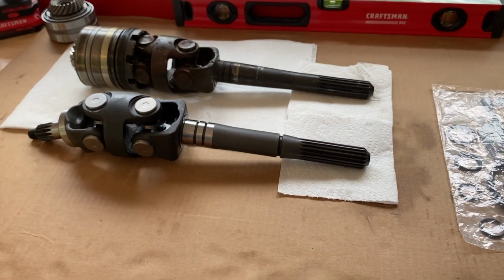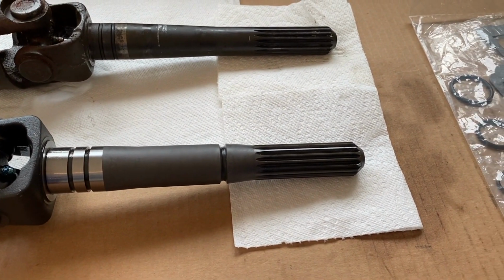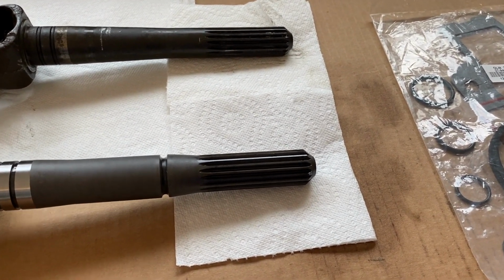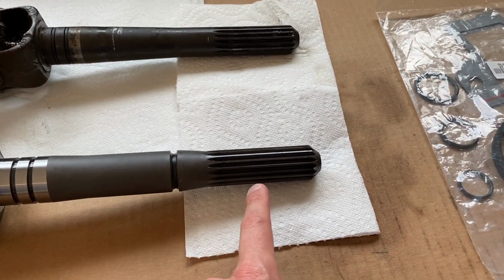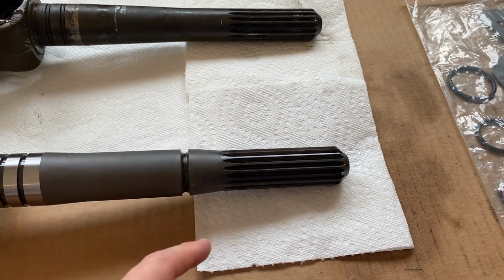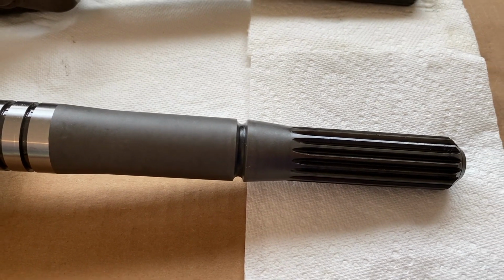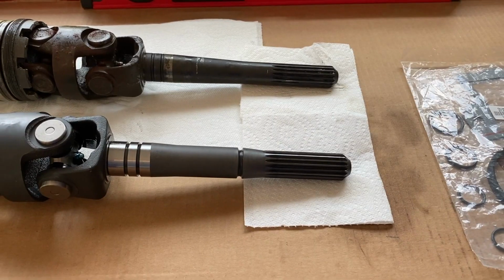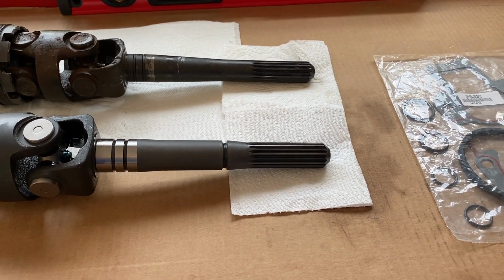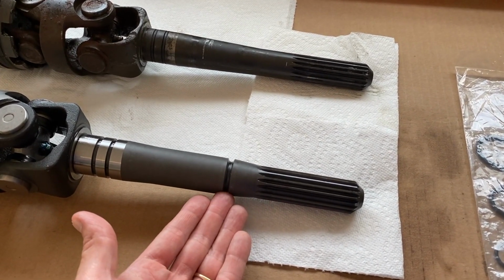I'm going to answer that question right now. That came later down the line, and this is the new shaft designed for the newly engineered and designed engine coupler inside your engine down below, which this entire U-joint assembly and yoke shaft slides into. That new coupler is a greasable coupler, and that new machine groove is for an O-ring, which creates the oil tight or grease seal when installed in the brand new coupler. In the event that you do not have that brand new coupler, which most people don't, me included, we are not going to use this new machine groove feature or O-ring.